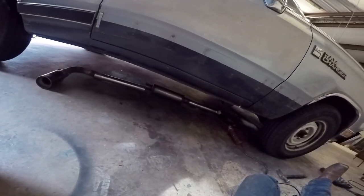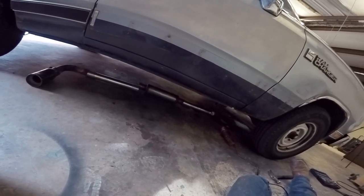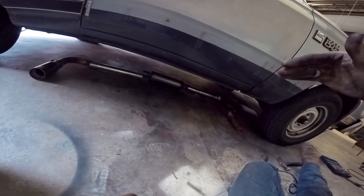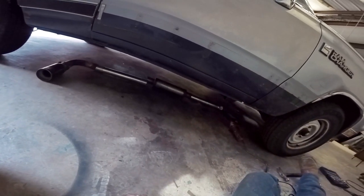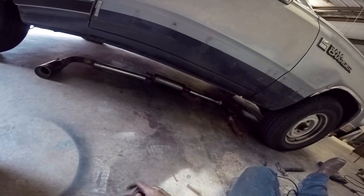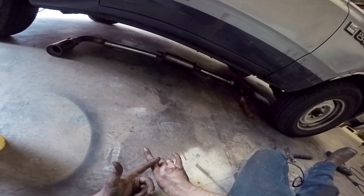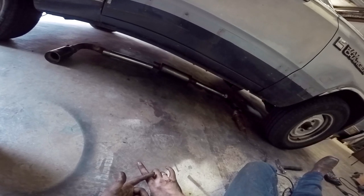On another note, the SMOG pump pipe, I forgot to mention, and I kind of forgot about it, my apologies, is that there's that pipe that we unplugged, that one that snuck through everything, and then it runs down the side of the engine to the cat. Well, that one has two brackets. One's accessible in the engine and one's not, and I'm going to insert some photos here in a second of that. And then there's one that's the same mount that a bolt goes through into the transmission, and also holds your dipstick for your transmission in place.